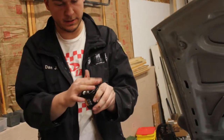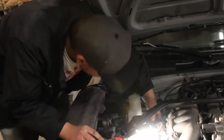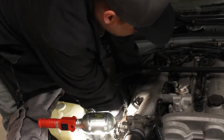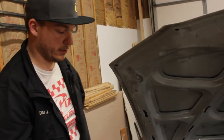Lubricate the gasket there. I'm going to go ahead and slide this on — hopefully it still fits. Oh, it fits. Barely — God, that's close clearance. As with any oil filter, you want to make sure it's on tight, but I wouldn't put a tool on it to tighten it down.